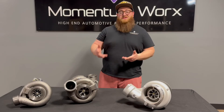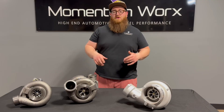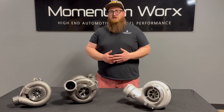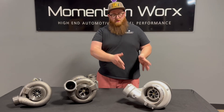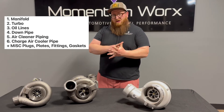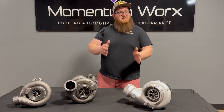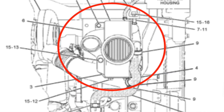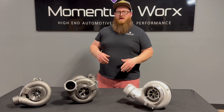So if you're switching to a single turbo — for the sake of conversation we're talking about the BXS, MXS, and NXS; the SDP is a C15 emissions motor with ball bearing turbos and its own issues, so we won't cover that — you need a manifold because the factory manifold has a different flange than what the single turbo uses. For a single turbo kit you'll need: a manifold, a turbo, oil feed line, oil drain line, new exhaust piping, new air cleaner piping, and a new charge air cooler pipe since you'll be getting rid of the pre-cooler. The pre-cooler is not an EGR cooler — they're two different things. The pre-cooler is basically a little radiator cooling the charged air before it gets to your charge air cooler.